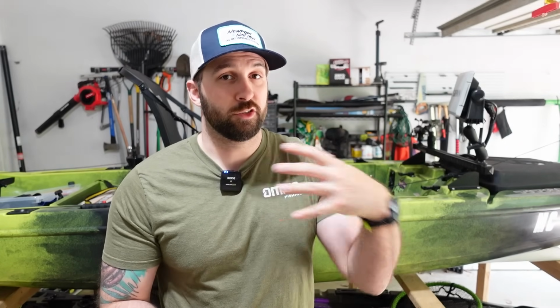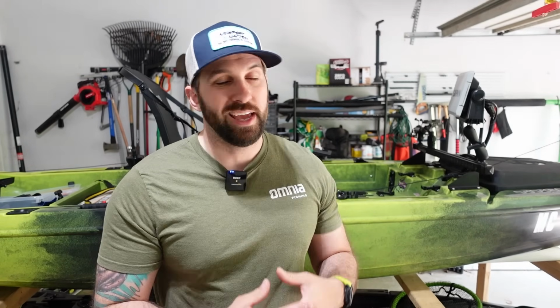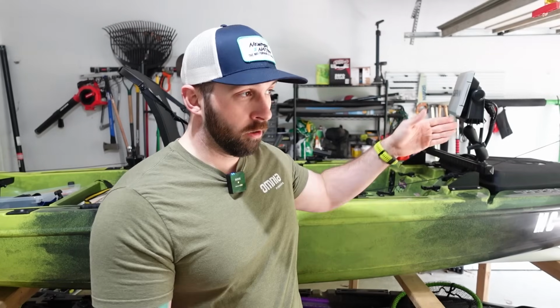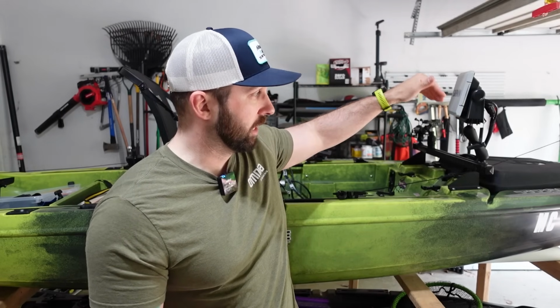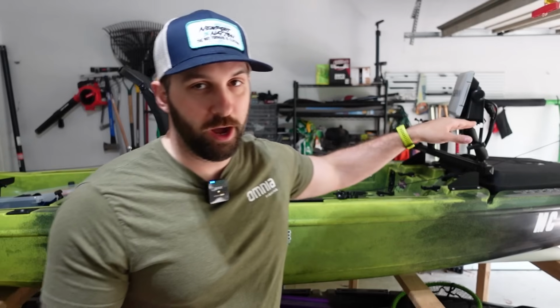The reason I think it is, even though I'm paying that premium, 100, 150 bucks, is because I'm getting everything sourced for me, especially the most frustrating pieces, which would be the hardware, right? So sourcing the correct size bolts, all of that is a pain in the butt. You can't just use the ones that come with your Xi3 because you need 4 long bolts for the quick release to go into the brass inserts at the front of this boat. And you need the correct slightly shorter screws that go through the bow mount bracket, which I'll walk you guys through in a second.